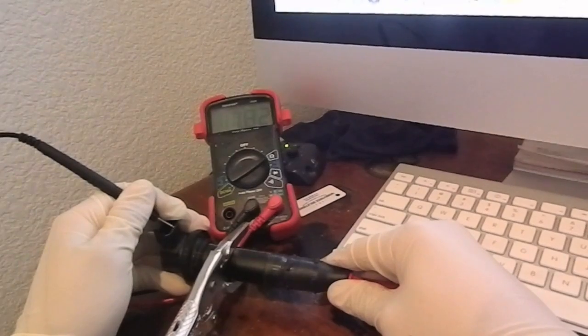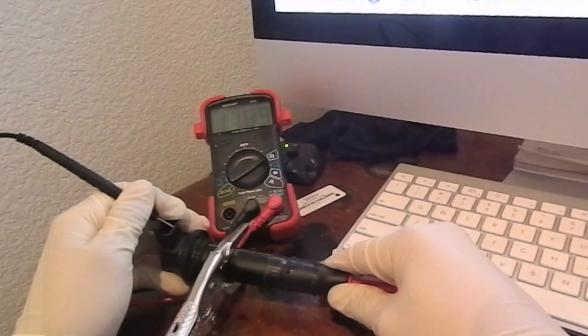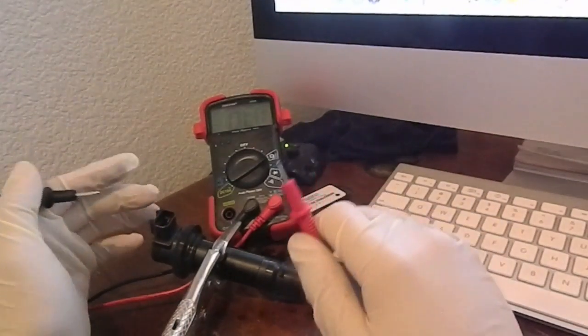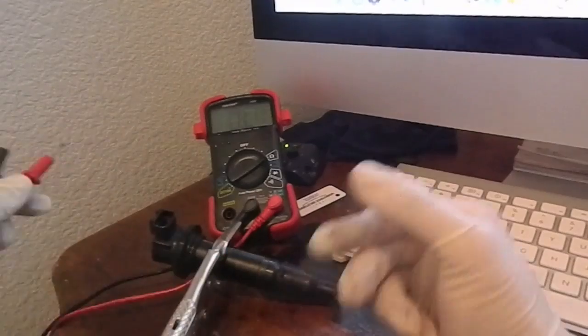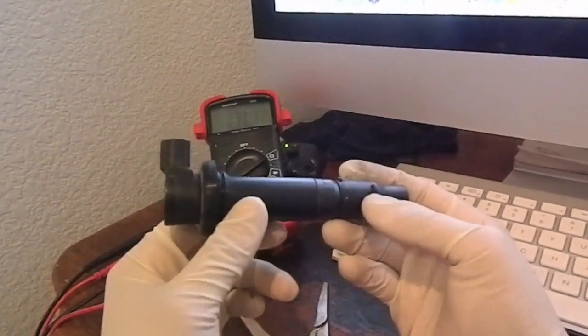You can see it's saying 7.82, which is way below the specs that the resistance needs to be at. Now remember, this is also a cold test. There's another way to test them — because problems usually happen once the bike is warmed up. You might want to stick them in the oven, heat the coils up to about the temperature the bike gets, and retest. You might get different readings because the coils are warmed up. But as a cold test, this is the one giving me the problem, so I've ordered new ones.